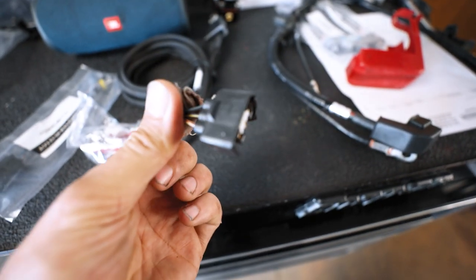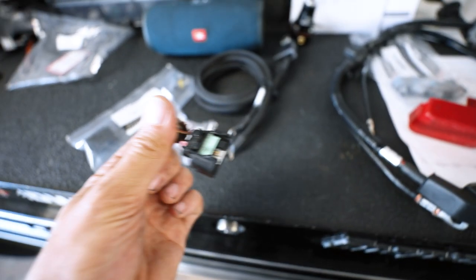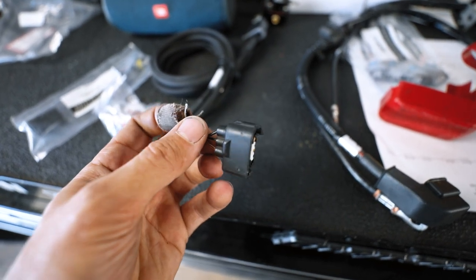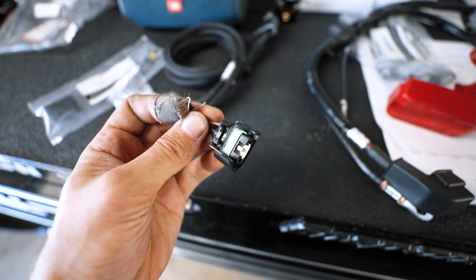I have a bunch of different lines — I think I have like three different people's kits — but they don't work well around the TGVs. To brainstorm around that, I cut the TGV connector off of the old harness so I can plug in the TGV and see where the fuel line is going to hit. It's good to have little things like this for reference, not to mention there's no way I was using that to begin with because it's all cracked.